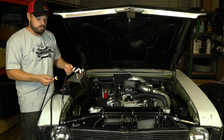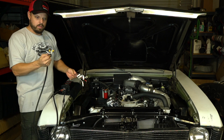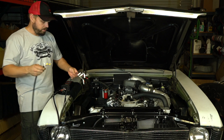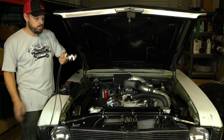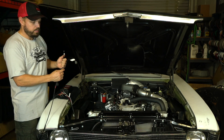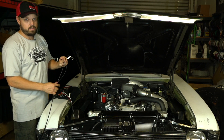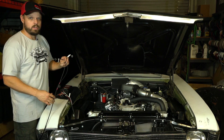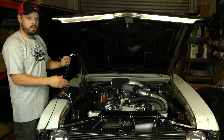For the wire harness install, it's important to make sure you route things carefully. The high-output wires need to be routed separately from the main harness with the battery and switch inputs. For the battery hookups, make sure the battery wire is actually connected to the battery. That way, you can ensure it gets strong enough voltage during cranking to actually start and spark and fire rich mixtures.